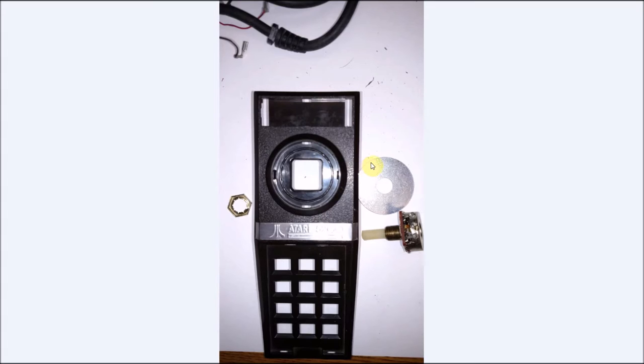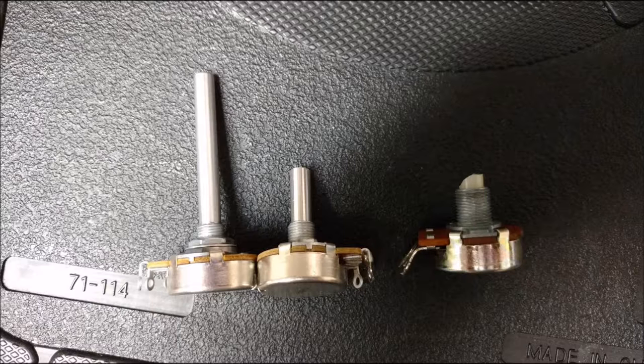So you're going to need a rotary zip or a grinding tool, and just go around and grind off the edges. Take your time, won't take too long. It gets very hot, so either be like me, constantly blowing your fingers, or get a pair of gloves as you grind it, and then you can put it right in here. It'll sit in nice and tight and snug. Again, my original paddle controller, I went out here, but I left this in place. And this particular one, I still went on the outside, but I shaved this off just to make the washer sit down lower. Again, it was just a preference. I think I'll do that from now on, just shave this off and go to the outer ring.